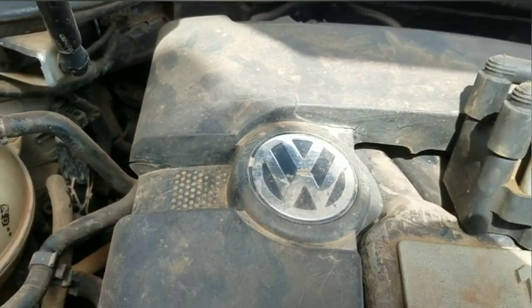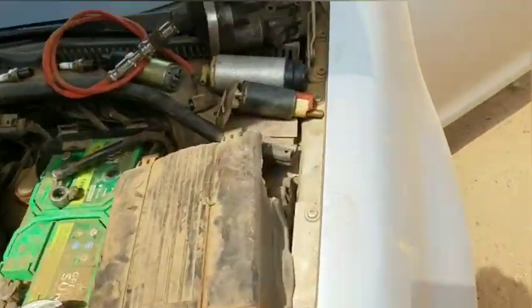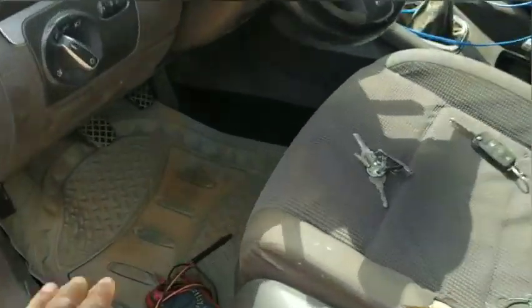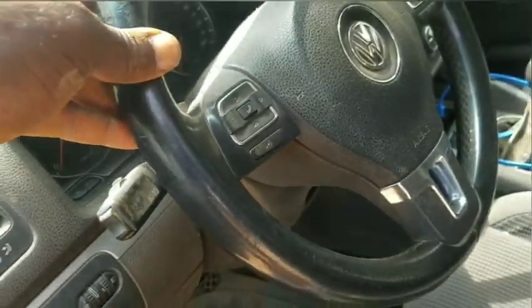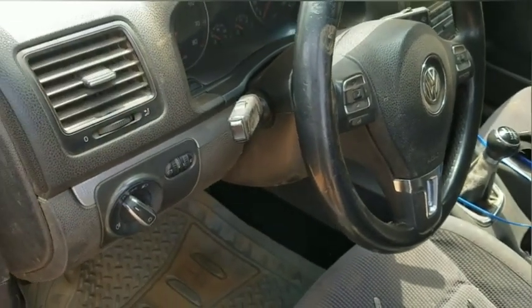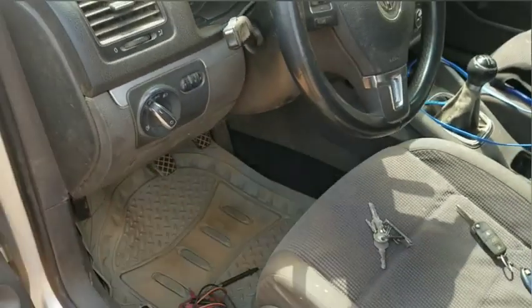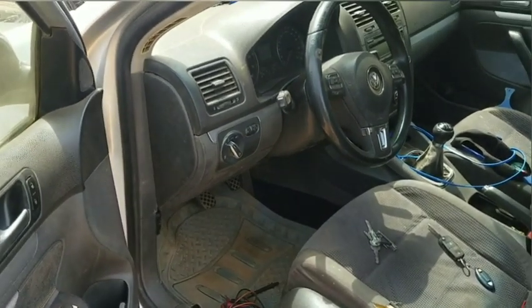Now, for the ABS control module, you drain the power there after disconnecting, and you step on the brake pedal multiple times. Then that is done. You can also switch on every other manual switch, as with the headlamp I've just shown you here, to make sure that every power that is stored in your circuit that has not been drained is completely drained. By so doing, you have reset the control modules in the car.